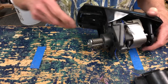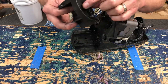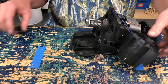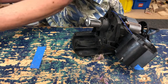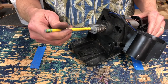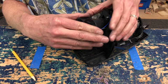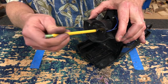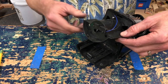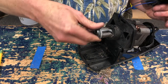So before we put it back together, let's take a look at it. The switch is in here — there's a little switch right there, so when you put the pencil in it's pressure-sensitive to turn it on. That's what these wires are for. I'm not sure if it's going to work if I can test this without it. I just plugged it back in — let's see if it works. Let's get the switch back in place. The case needs to be back on it before it works. Now it's turning! The nail came out and now it can turn. So I'm going to declare this fixed.